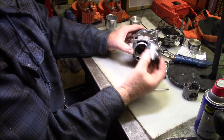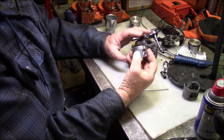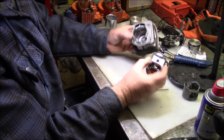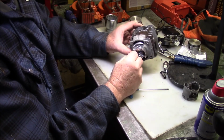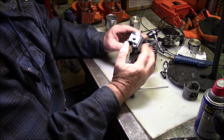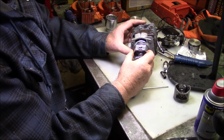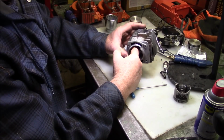So by me putting this piston in here, right, with the pop-up, higher compression ratio, different material, single ring, not knowing what the expansion rate difference between this piston, with its material and heat transfer capabilities, is relative to this, is it possible I'm setting myself up for another cold seize? And I'm going to say yeah, possibly.